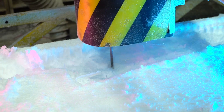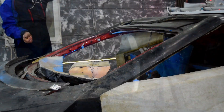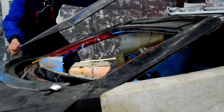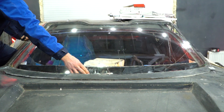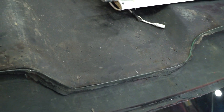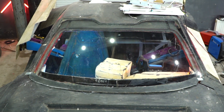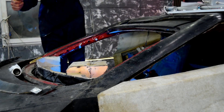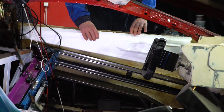I began to cut out the door sheets from foam plastic on the NC machine. In the meantime we can try on a custom windshield made according to Triplex technology. Due to the non-standard cutout at the top it must be handled very carefully. To save money I decided not to make the black edging at the edges for now — after final fitting this can be done in manufacture or tinted with black film from the inside. It fitted like factory assembled. There were some moments where the body needed to be sawed, but I asked to make it a couple of millimeters larger just in case, as fiberglass is easy to rasp under the glass size. I removed the glass out of harm's way — it'll be a shame to split such an exclusive windshield.